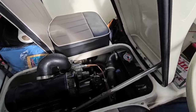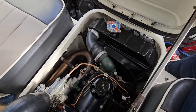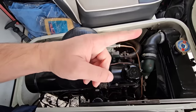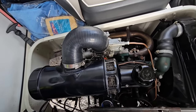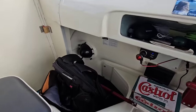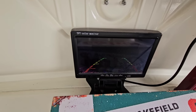With the hump lifted, it's got its own stay just like the tailgate on many cars of this era. We can find the engine - a 1703cc four-cylinder straight out of a Ford Consul. We've even got the radiator in here with us as well, so it must get nice and warm, especially for the passenger sitting right next to the exhaust. I believe these engines were slightly detuned from the car version. It's certainly easier to work on and you stay dry because the engine is just there. There's a tiny little carburettor, spark plugs all down here. The owner has very wisely fitted a reverse camera so I can actually see what's behind me.